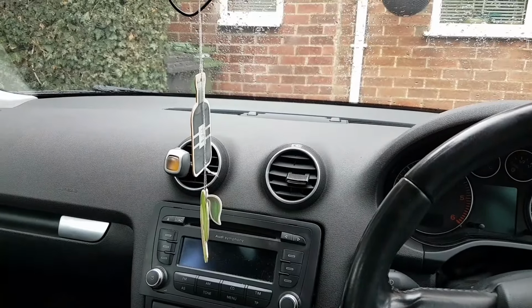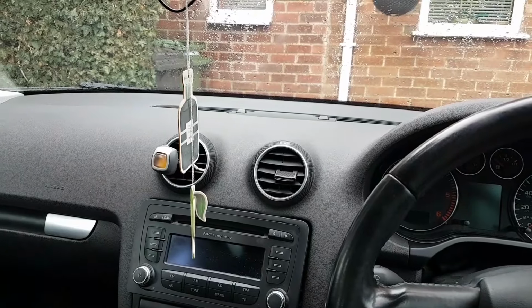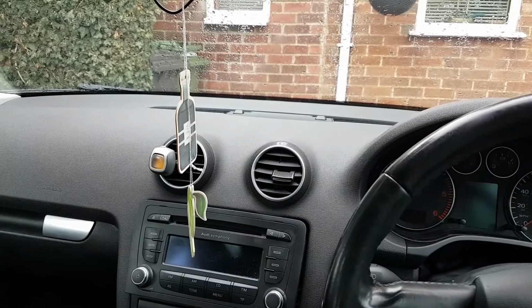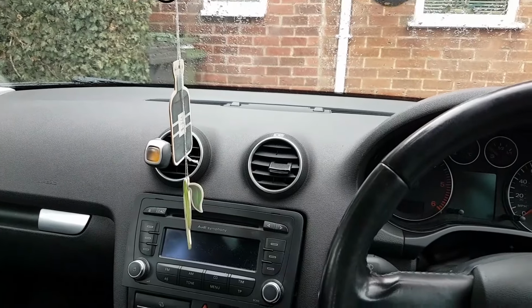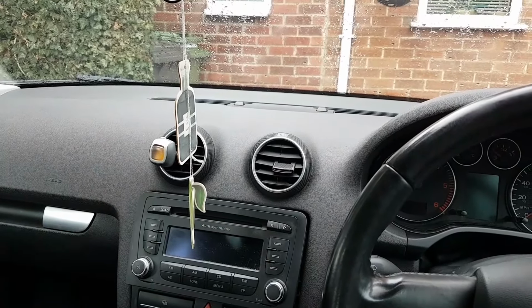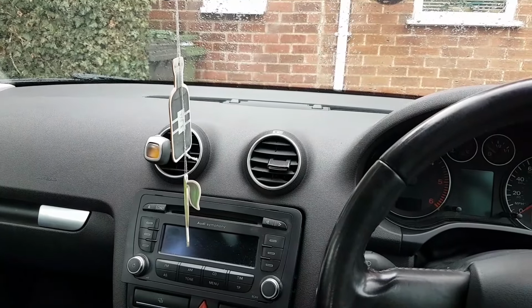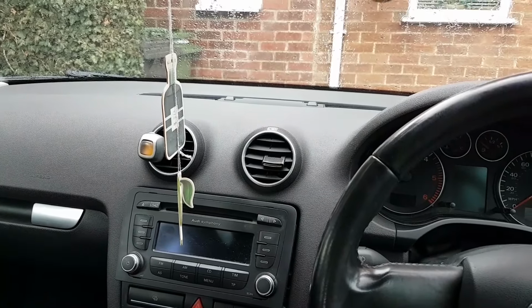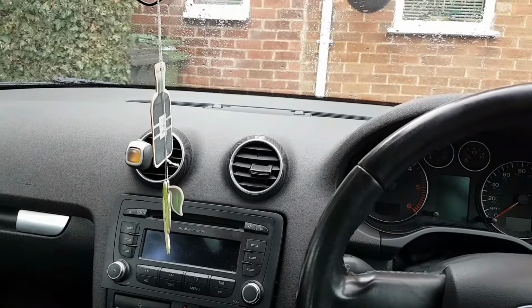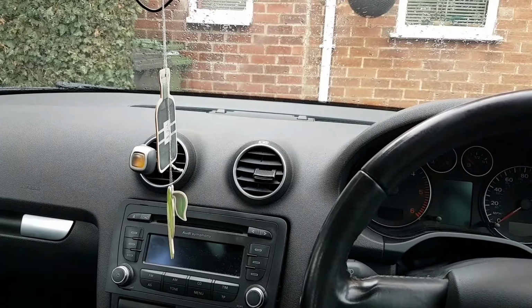According to the diagrams, the only thing that fuse feeds is that oil level sensor. The car runs fine. Well, the car came with the fuse already popped out anyway, and it's been driving like that before, so the guy didn't complain about anything else. And the diagrams, as I said, showed that the fuse feeds only that level and temperature sensor.